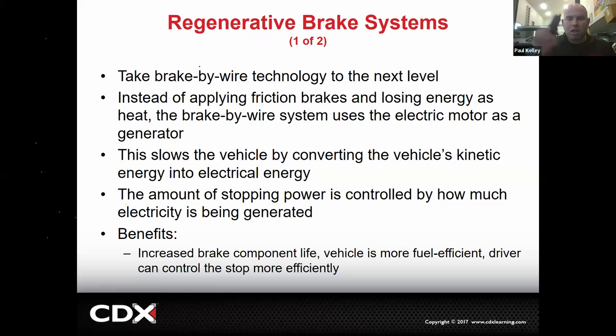Just hanging out. But in the meantime, this computer is working with your AC motor and saying, like, more regen braking, decrease the frequency more, act more like a generator, slow us down. Because if you think about it, your foot makes a certain amount of pressure. It takes that pressure and makes it into a voltage. It interprets that voltage and it commands the generator to reproduce what you're asking for. So to you, you're like, oh, these brakes feel great.